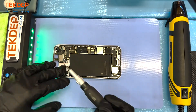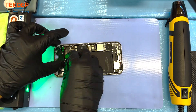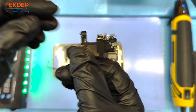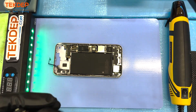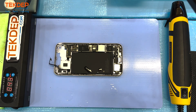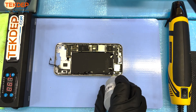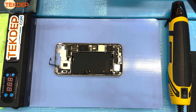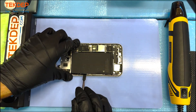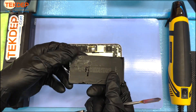One thing to note is that Apple used a mid frame for this phone since it opens from the front and back, so it's not a fully fledged frame — there's less adhesive even though it carries the same IP rating. To disconnect the battery from the mid housing it is best to use isopropyl alcohol at 99 percent. Just let it warm for five to ten minutes and it should pop out easily without giving you too much grief.